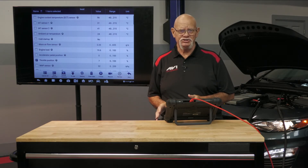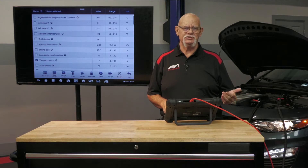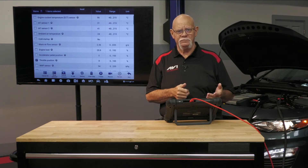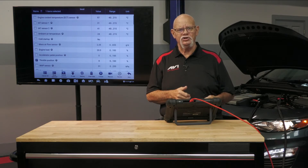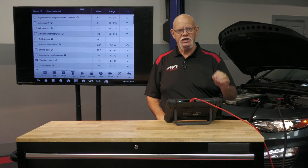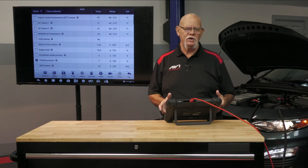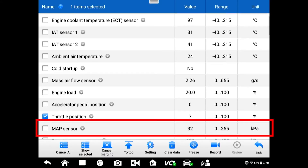My tip is there's a lot better resolution — get away from inches of mercury. For example, if I wanted to sweep-test the MAP sensor and hook up my handheld vacuum pump, don't watch the numbers change in inches of mercury. Change the vacuum to the MAP sensor and watch the kilopascals change in KPA numbers 1 through 100. That's going to give you a lot better resolution. A good strong engine idle vacuum, as we see here on this 2020 Malibu, is around 30 to 32 kilopascals of manifold pressure.